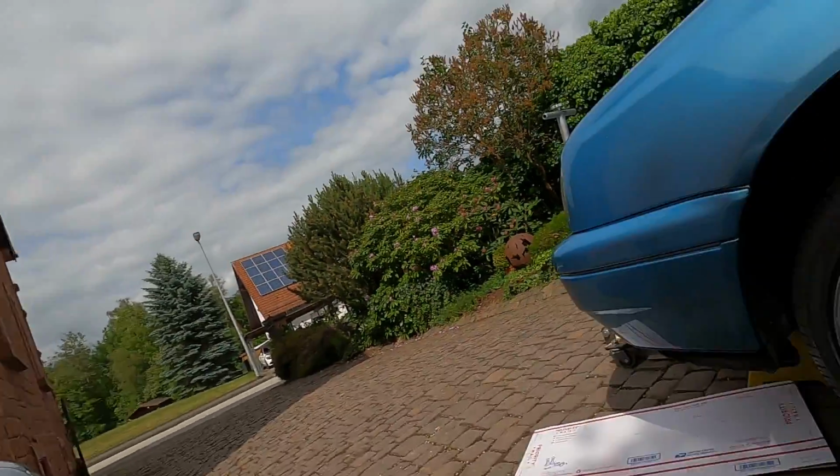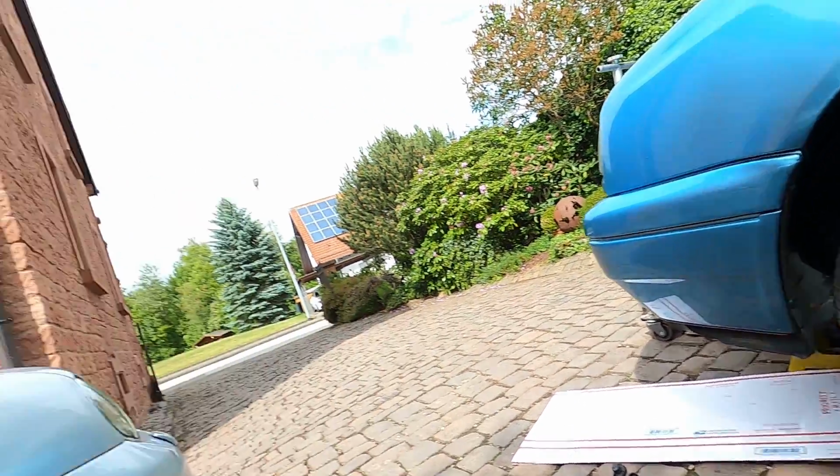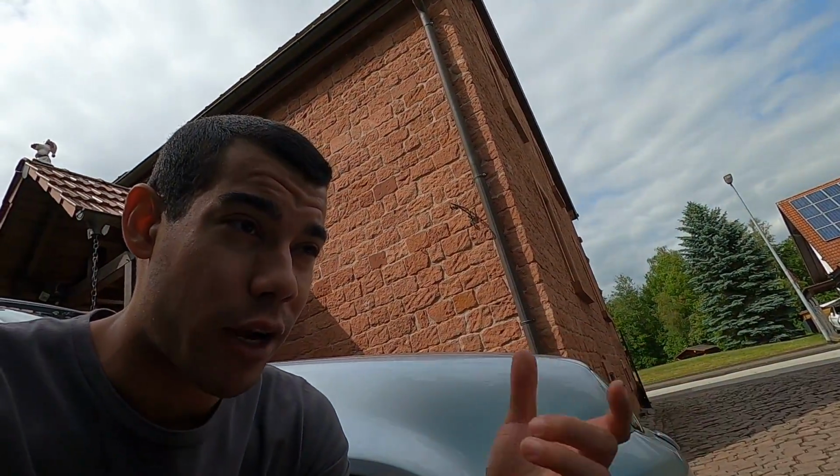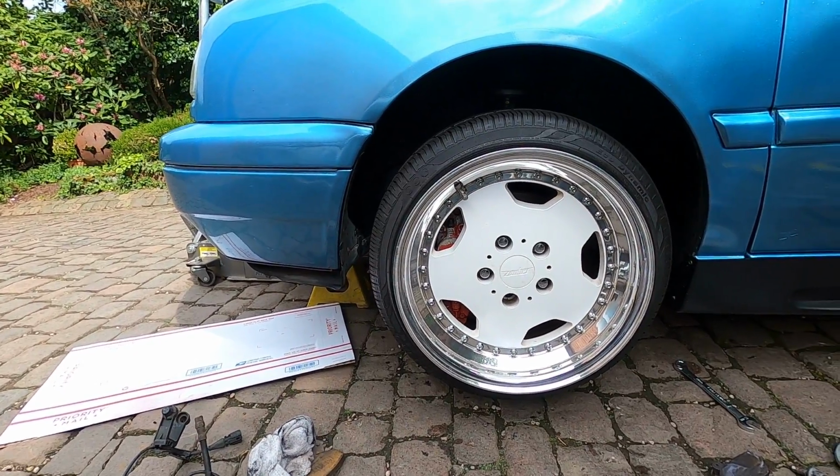And honestly though, where the caliper is sitting right now, it'd actually be sitting normally up about another maybe 5 or so millimeters, since I had that screwdriver holding it versus an actual bolt. It's not in the exact right spot. So honestly, where that top bolt is holding the caliper might actually be working right now. But if we get the proper adapter for this caliper to my Mark III front end, man, what started out as a joke now may actually work.